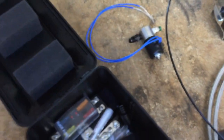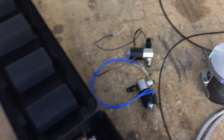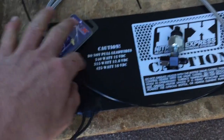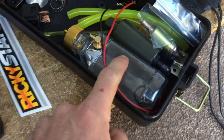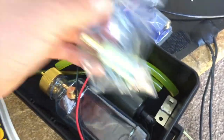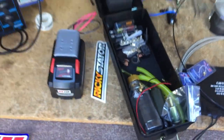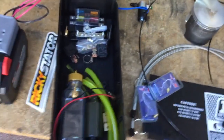The bottle heater draws maybe 240 to 315 watts — probably 15 to 20 amps or so. Here's an RC plane fuel tank I may use as a standalone fuel tank for the fuel pump, plus a fuel filter. Or I may drill a hole in my 4-gallon Clark fuel tank, put another petcock in there, and run another fuel line back to this fuel pump — then I wouldn't need the filter or standalone fuel tank.